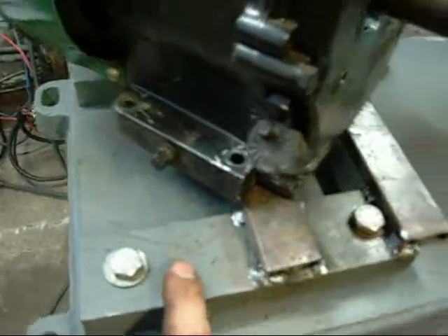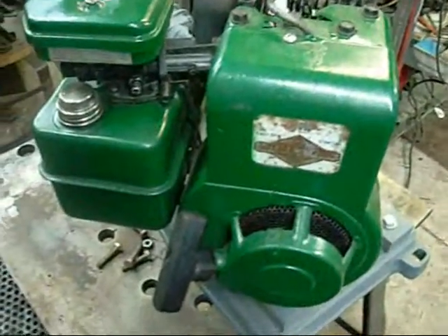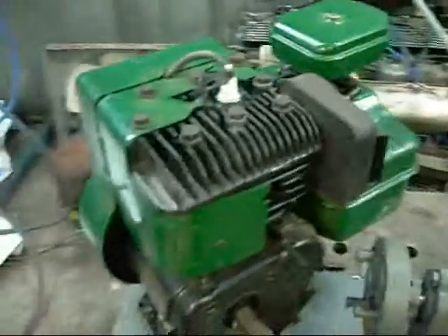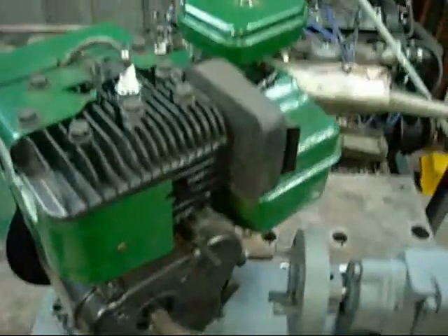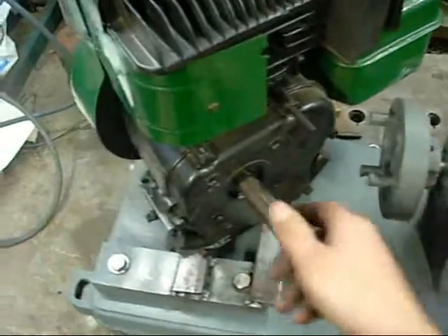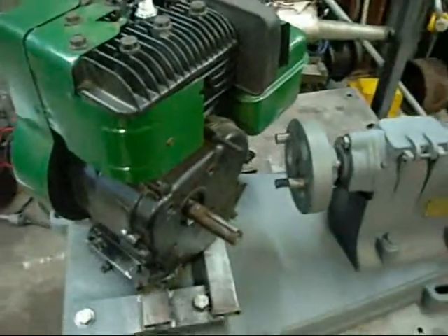I've cheated a bit and welded some crossbars to these spacers. If I want to put the original motor back on, I'll just grind them flat and fill in any little dings and scratches. For now I'm using the Briggs and Stratton 4 horsepower 1971 model. I was going to use the Villiers, but the shaft and positioning of the mounting feet is way too short — even this one only just makes it. The Briggs is a lot easier to convert over, it's got more horsepower and more parts availability. The Villiers is too nice to put on this.